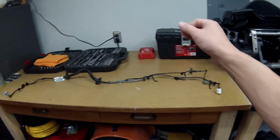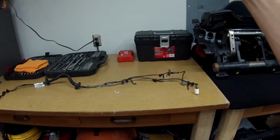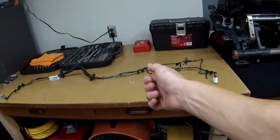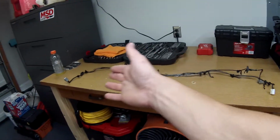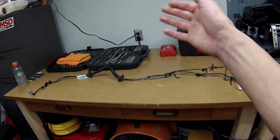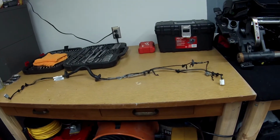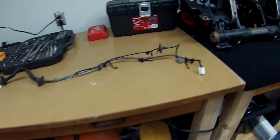This is the one that controls your license plate lights, whether your trunk is open or closed. It's your remote release for your trunk hatch. It's all of those things. So that unit is, I keep getting a warning that the trunk is open, but the trunk is not open, okay? And it's just kind of off and on finicky, which tells me it's kind of like a wire issue.